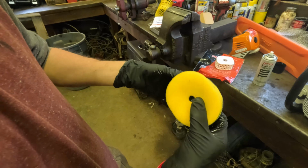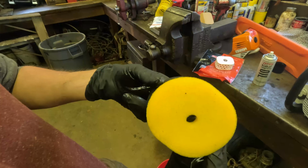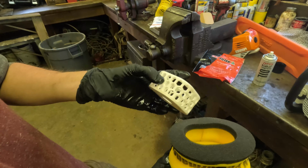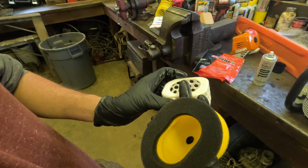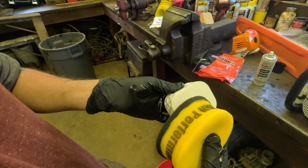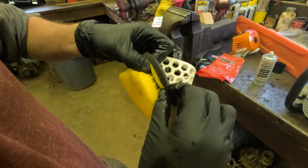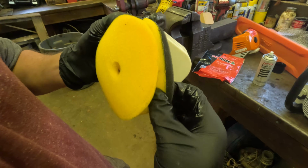Alright, so now once it's oiled, or if you did it the liquid way, once it's not dripping off of it, you put this cage on it. So you want to make sure the opening on the filter you put towards the opening on the cage here, otherwise you're going to restrict the opening. Not really, but you might. I imagine that's why he designed it that way.